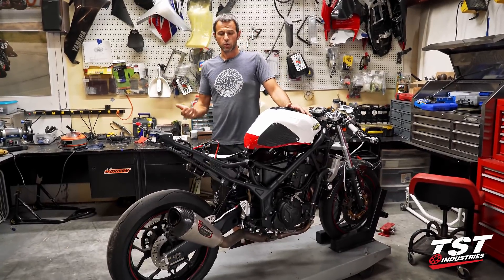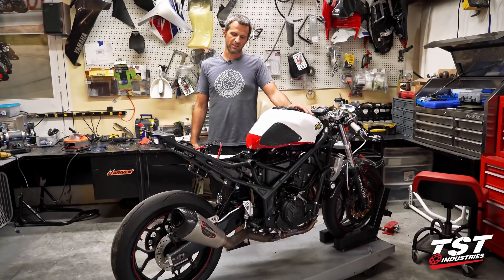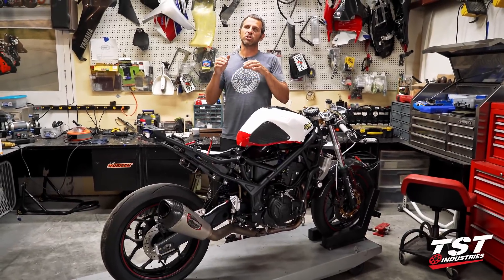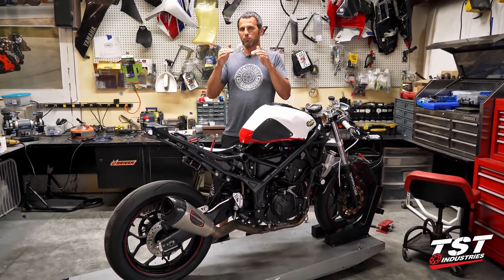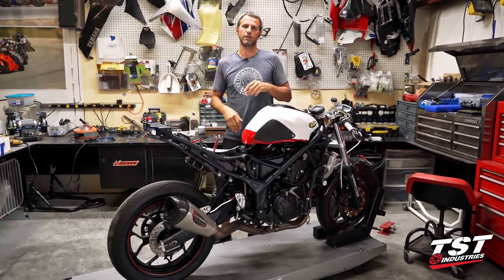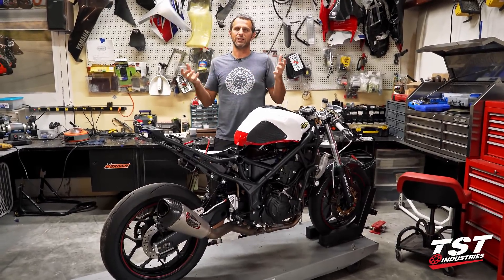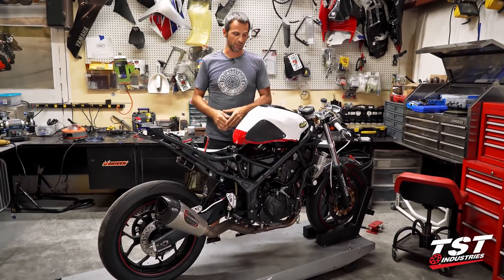As the bike is shifted from redline back to the operating range, it's going to keep pulling faster through that RPM range. The torque increase was only about 0.2 — we went up to 23.31 foot-pounds at 9,700 RPM, really just a 1% increase. But if you look at the graphs compared between the old runs and these new runs, it was higher in more regions and didn't fall on its face after 11.5. Using what I call 'motor potential' — basically integrating the area under the entire curve — we have made big strides to unlock more potential out of this bike.